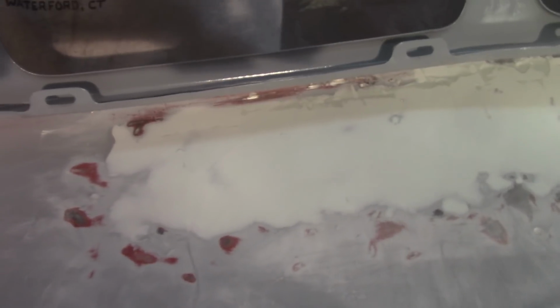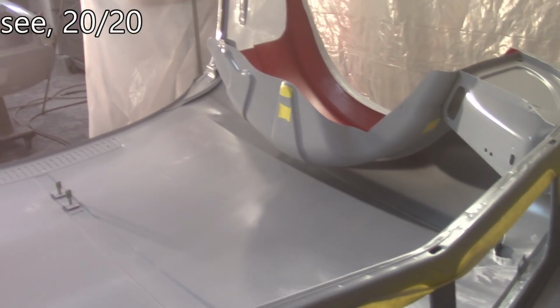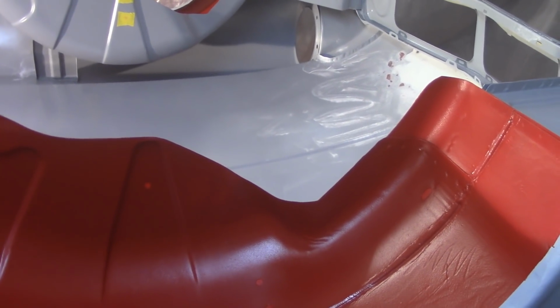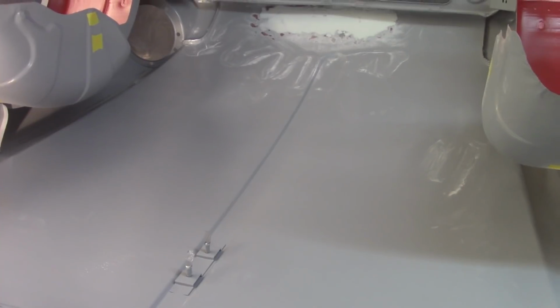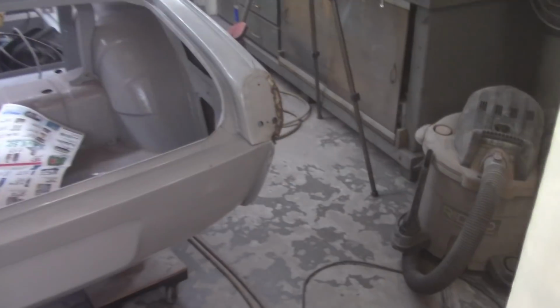So if I can swing this around here, it looks okay. Just smooth it out again. I didn't really care to get it all pretty and everything. If I had thought a little bit better beforehand, I would have probably put build primer on this first, because now what I'm afraid of is I obviously want to protect the area of the Raptor liner and want to tape that off before I paint it. Well, I'm afraid if I tape it off, it's going to rip the Raptor liner off until it's had a good chance to cure. So I don't want to do that. So I'm going to at least wait until the next visit before I get this in build primer. So I'm going to switch over to the body and clean up the tail light area here and get that all nice and pretty.